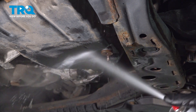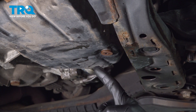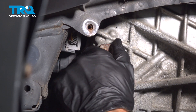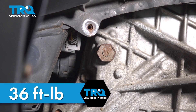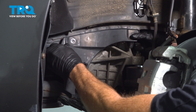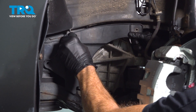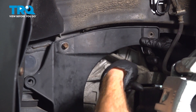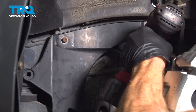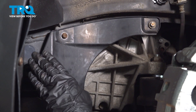Let's clean our mess. Now back up in the wheel well, go ahead and tighten up this fill plug and torque that to 36 foot-pounds. Now reinstall our plastic cover — we have two 10-millimeter headed mounting bolts, and there should be one push clip across the front. Double check to make sure that's completely secured in place.